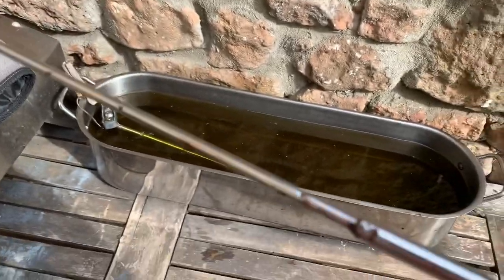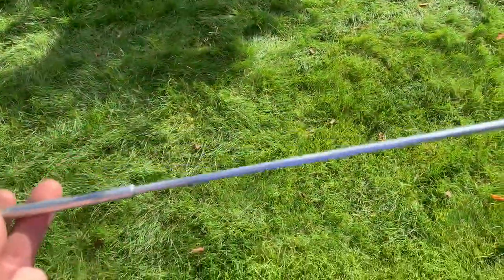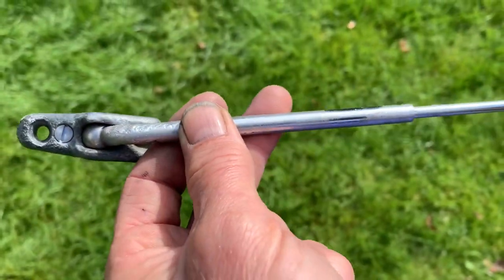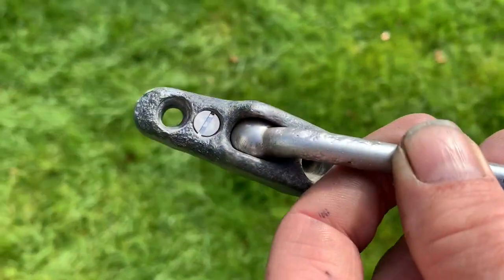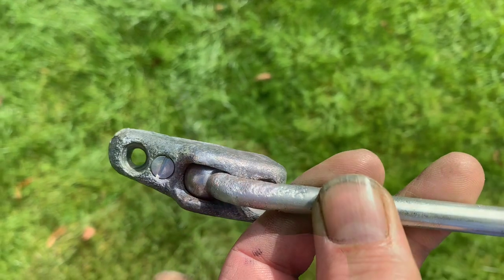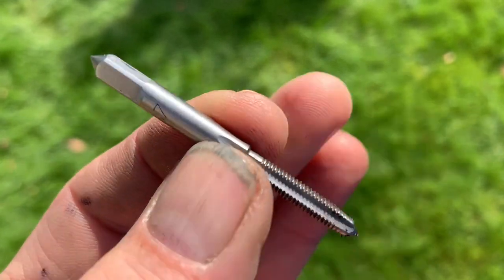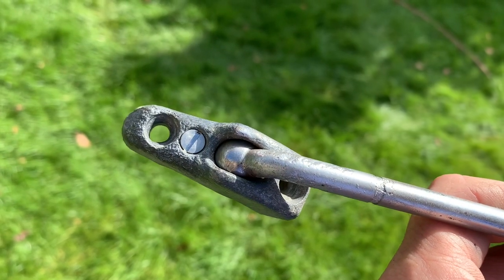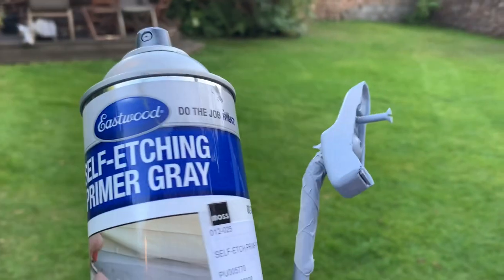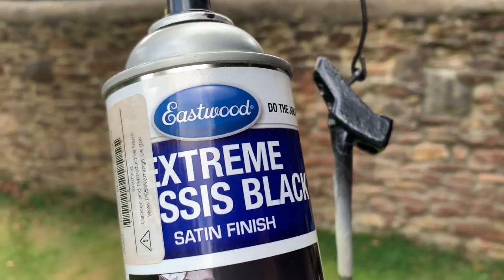Most of the rust is gone - we just wash off that rust remover and then go over it with a little bristle brush to get rid of any remaining bits of rust. I've taken all the rust off this chrome sunshade rail here and just dusted it over with some MRO chrome galvanizing paint. Just a little Dremel tool to get rid of any rust and corrosion off that end bit there, because you can't put that in a rust bath - otherwise it'll disintegrate. We've drilled out the old rusty screws and re-tapped the threads using an M4 0.7 tap.